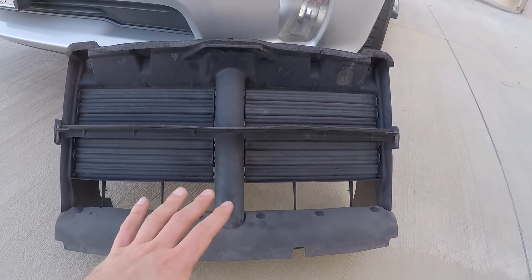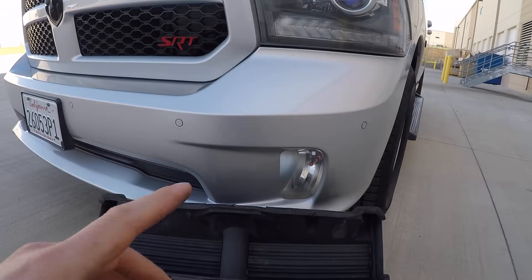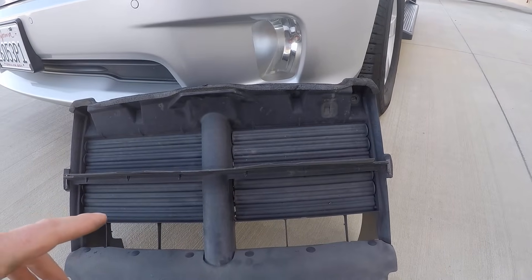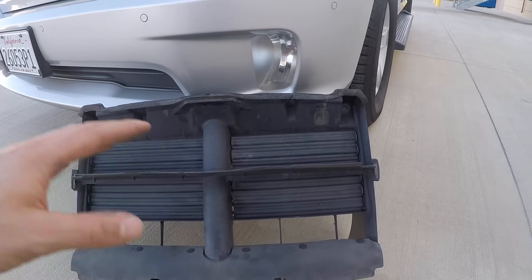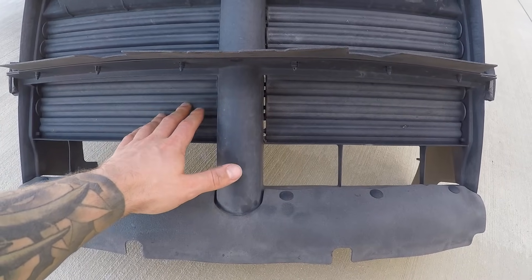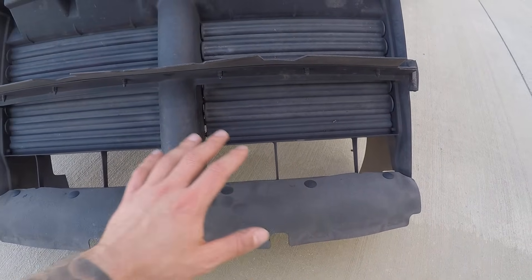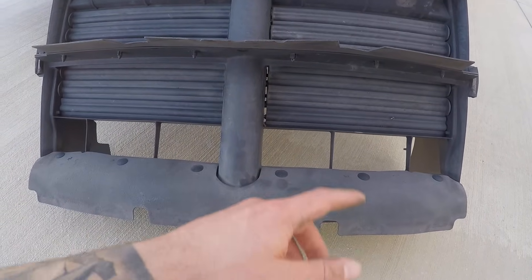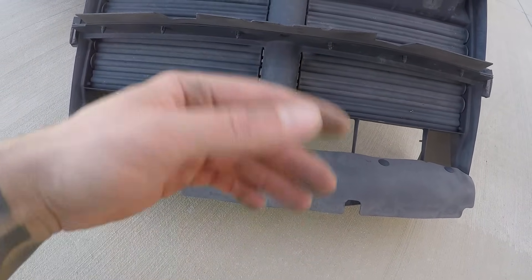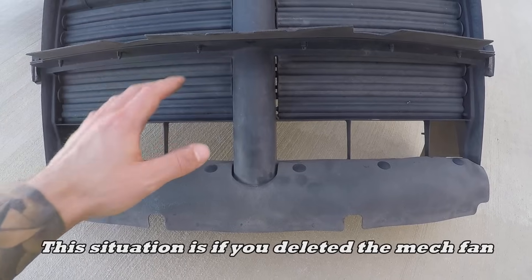Now let's get into reasons why you might want to remove them. If you've deleted the mechanical fan — which creates a load on the engine and robs a little horsepower — there's not a lot of free airflow passing through the radiator. You're only left with the bottom open portion, which stays closed the majority of the time on the freeway. The mechanical fan basically spins with the engine due to parasitic drag, which is enough to suck air through and cool the engine.